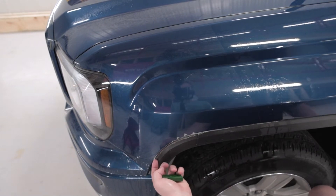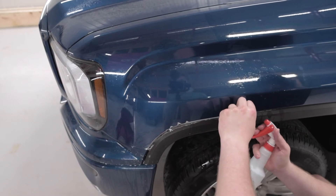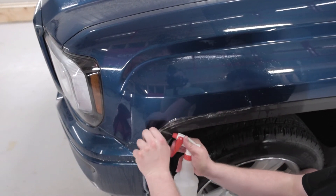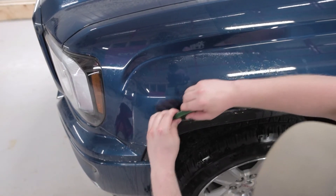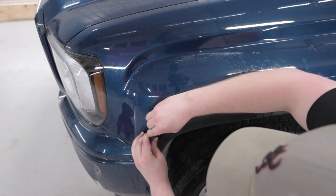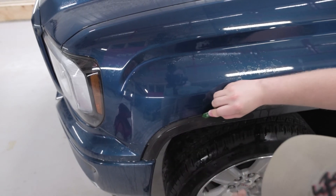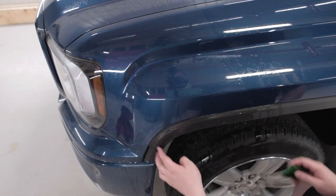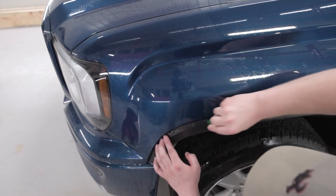All that's left is just this little piece right here. I like to pull the film back, spray some more tack solution in there, flush out all the slip solution, and just squeegee it all into place once again. Make sure that there's no moisture left on that edge, so I run the squeegee at an angle all the way along. Now that I know this edge is down, I can start over here and squeegee everything into place once and for all.